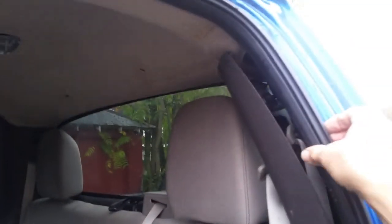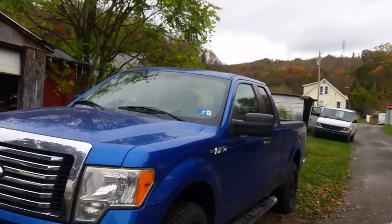So if you have any leaks, fix your light, and if you're still frustrated, check out your seal. Just pull your headliner down here — it's just a couple screws and some hooks. You've got a screw on the inside you have to take out too. Pull it down just far enough to look up in there and pull the seal off to make it a little easier. Once you do that, you can look back in there to see what's going on. If you fix that light and put some glue back there and it still leaks, check your back window.